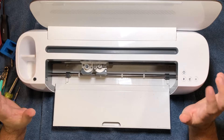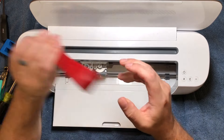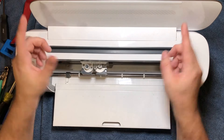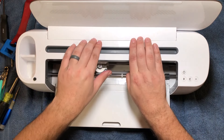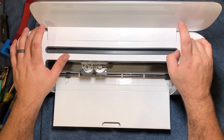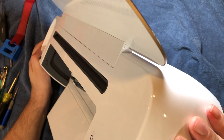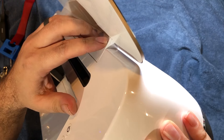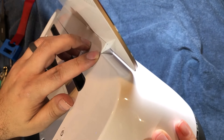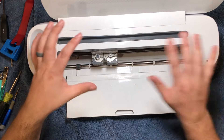The not-obvious stuff is going to start off with a bang. We need to get this cover off and it seems like you'd be able to just pry it up, but that's not actually what you want to do. There are four or five posts in here attaching it down and they actually lean back — so when you try to pull it up, you're bending it against the post. The second thing to realize is there is glue on these two sides, and in my experience one side has been nearly impossible to get off. Also, you're not actually lifting the whole thing up — the cover is just a thin little piece, and that's the piece you're trying to get off.